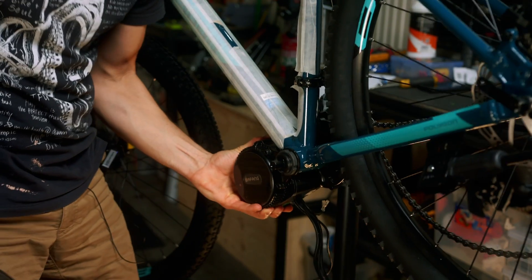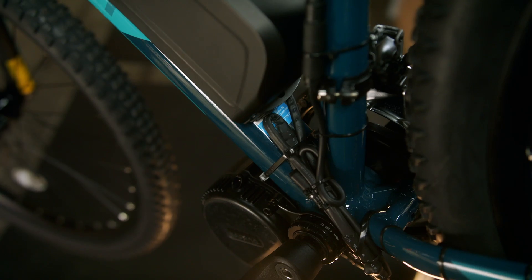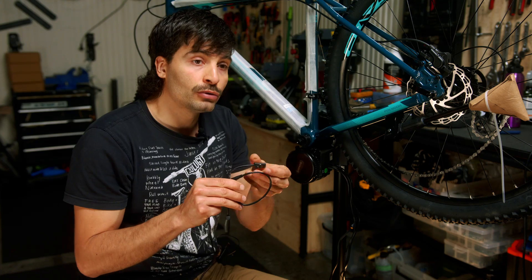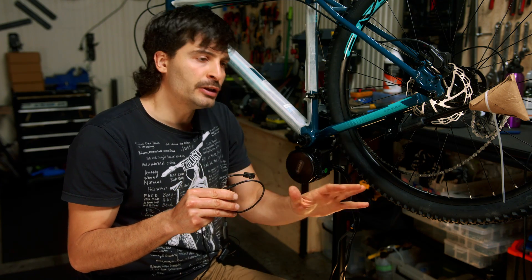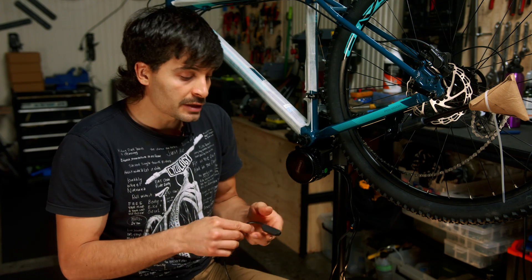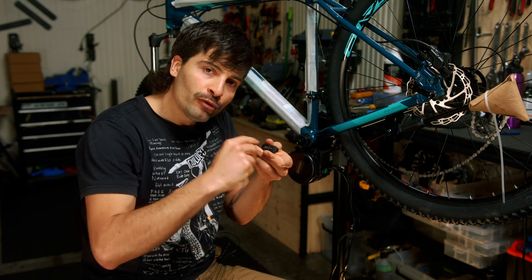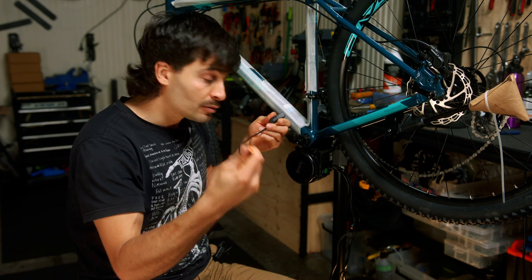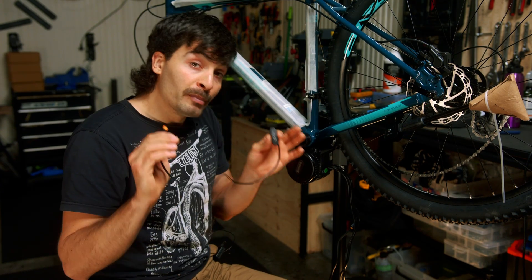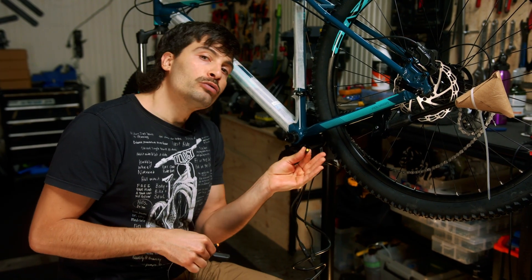I have here the brake sensor, which in my opinion is my favorite — you can control when to stop the motor. If necessary, you can press the lever and stop the motor. Or you can use the gear sensor: every time you click the shifter, the cable will move and send a signal to the controller to stop the motor while you shift gears.